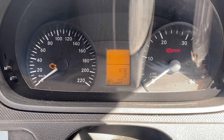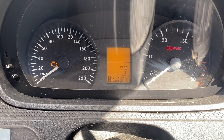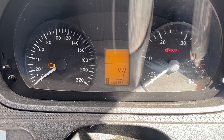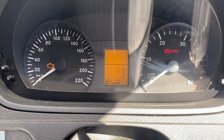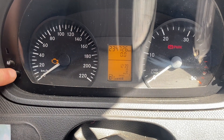I don't have a scan tool to hand here, so I'm going to be trying to do this manually and we'll see where we go. Let's turn on the ignition — the ignition switch has gone to position two. I have this stuff flashing; I'm going to leave it and allow it to flash until it stops, and then when it stops and goes back up to my odometer, I'm going to press and hold zero.